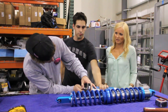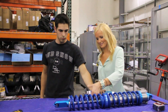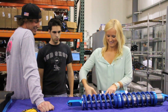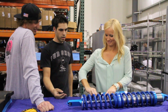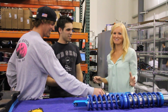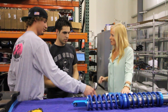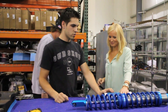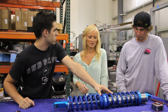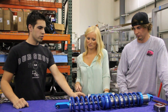Our RallyFighter shocks get charged to 200 PSI. It's our constant pressure that we set everything at. You might be asking why 200 PSI and not 100 — when you have more pressure inside this reservoir, it helps prevent cavitation, which is another way a shock can fade out by actually boiling the shock fluid inside momentarily on really hard hits. By running 200 PSI it helps prevent that, and of course it's for consistency.